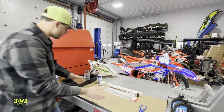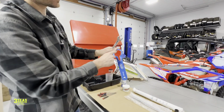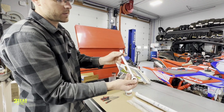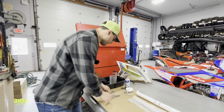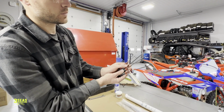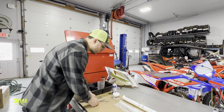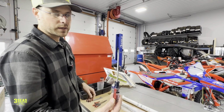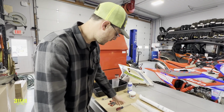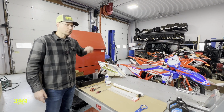And let's show you just some really basic tools. This is really simple. So we got our top cap wrench. Now I've been using this thing forever. We have a 19mm open end wrench. We just need the open end part of it. And then I have an assortment of pick tools that we're going to use. Got really lucky on the first one. It came out really easy. And then just a regular flathead screwdriver. So that's it. There's really no tools. It's a couple of pick tools, a 19, a flathead, cap tool. So let's get that pulled off and I'll bring it over to the bench.